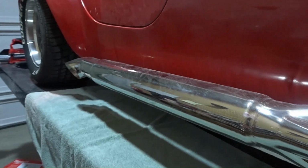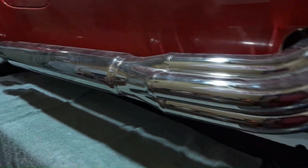Now, I have not attached the rear hangers yet, and I'm going to wait. I'm probably going to be doing that in the next video, because what I want to do is get the car back on all 4 tires, and I'm probably going to do ride height and corner weighting to this car before I adjust the side pipes. And once that's all done, then I'll adjust the side pipes so they're level on the side of the car, and then I'll figure out where the hangers need to be. Now, this hanger assembly is completely different than what Factory 5 uses too. So I've already been online looking at the procedures for mounting the hardware that came with the side pipes, and I'll get to that when we actually do that part of it.